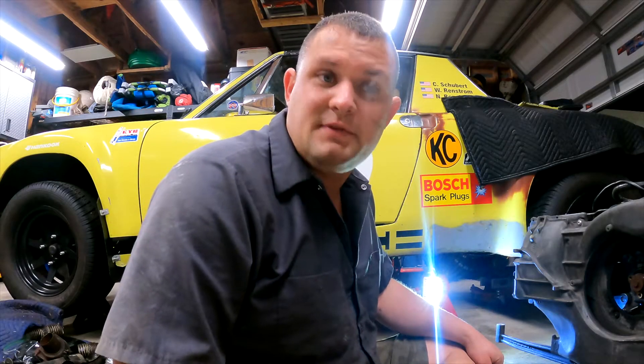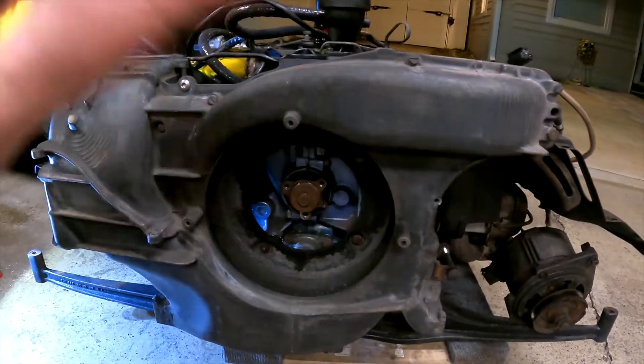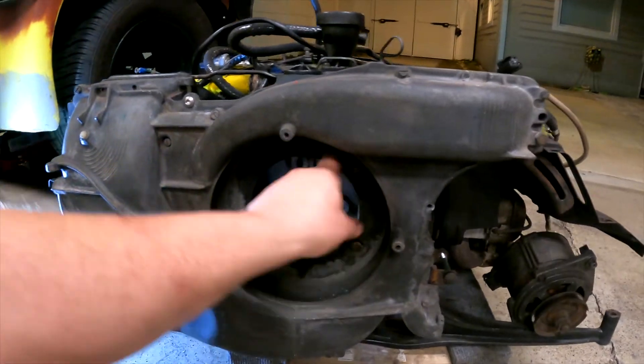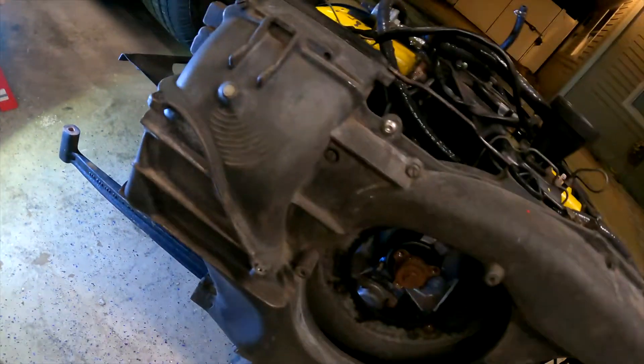Alright, now that I've recovered from the 59-minute engine pull, let's take a look at what we're doing here. I need to access a bolt up here — honestly, it's out of the car at this point, so I may as well just do it. We're going to take this shroud off: four 13s here, a couple 10s up here, you'd have to remove the alternator, and two bolts over here.